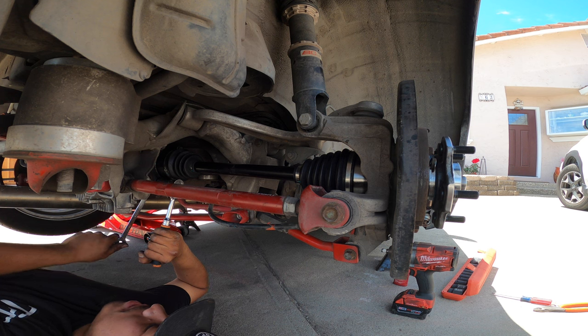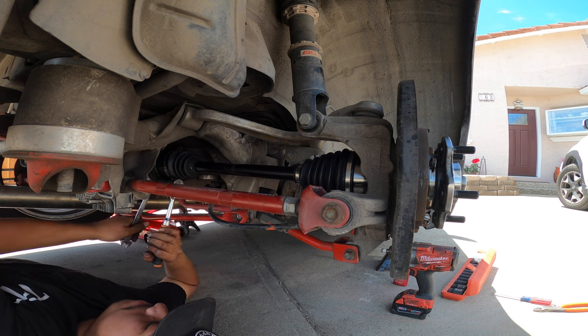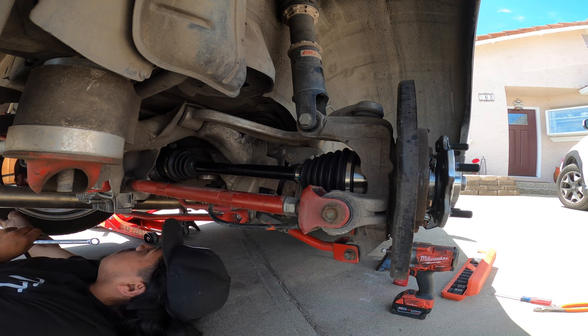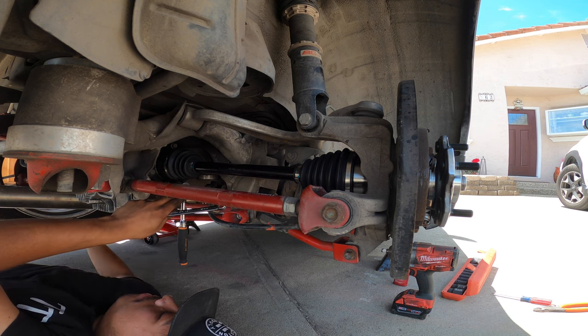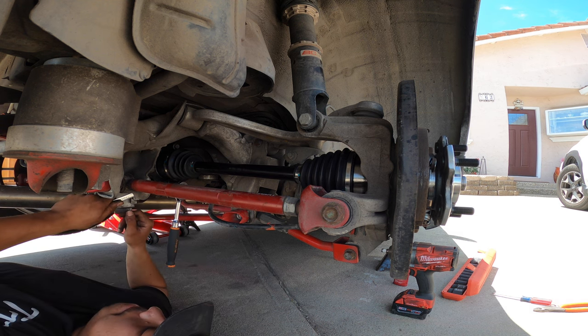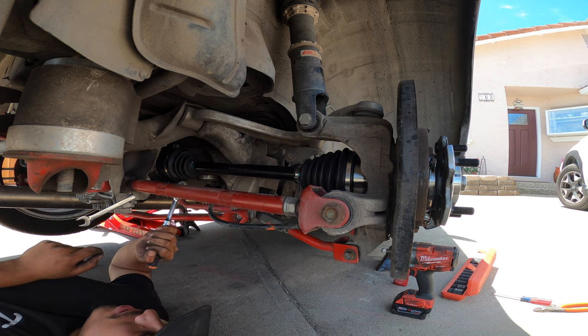So what you do on any car when you launch is you drag the clutch. You just barely get it to where the car is creeping. You step on the brake, or e-brake if you have it, which is nice. You can hold it with your hand, and then you get it to your desired revs, and then you dump the e-brake and the clutch at the same time. That way your gears and everything are already loaded, and they don't slap back and forth. It's the shock loading. Oh, I get what you're saying. That's what messes this up, huh? Yeah, shock loading. It's the slapping of it going back and forth. So I already load it, and then I just drop the e-brake? Yeah, e-brake, give it gas and let the clutch out.